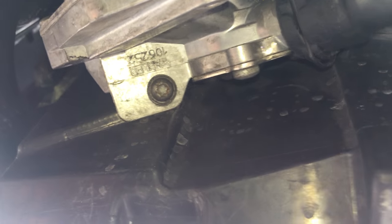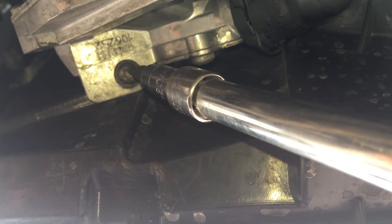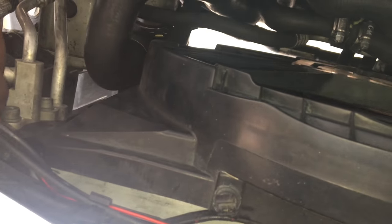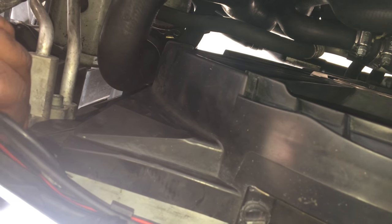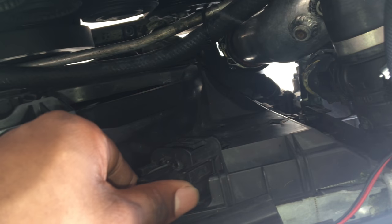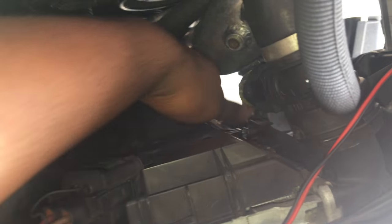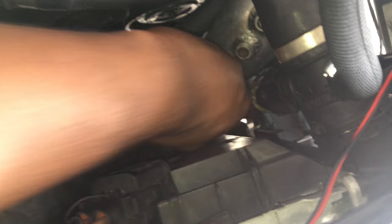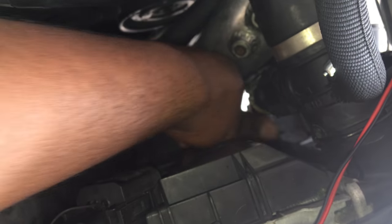Since this is automatic, I'm going to disconnect the trans cooler from the fan assembly using a T20 to take this bolt off, then move it over to the side. Now we should be disassembling the fan. There's a bolt here — use a T20 to take it off, and also take off the power plug by squeezing and pulling up. Then on this hook-looking piece, just pull it forward and pull up. Once those are disconnected, you can pull the fan right out.